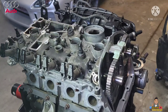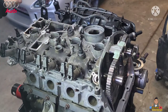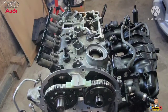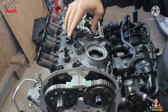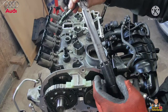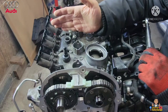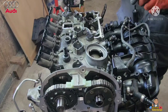Alright, we'll put some bolts in there — a couple bolts on the front and the back. Let's torque all these valve cover bolts. The torque spec on this is 9 newton-meters, and to convert newton-meters to inch-pounds that would be 80 inch-pounds. My torque wrench here only reads inch-pounds, so that's 80 inch-pounds for all these bolts on top. The pattern is to start with the middle and then work your way out zigzagging.